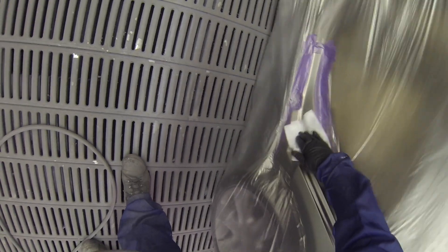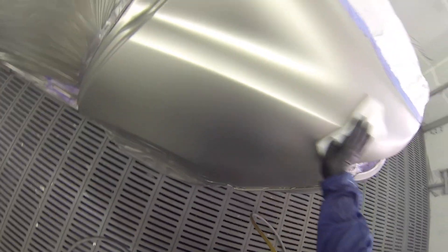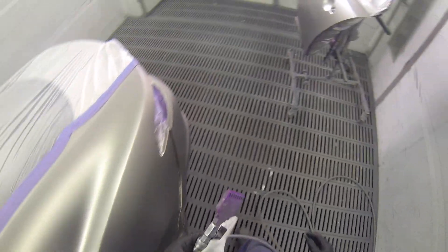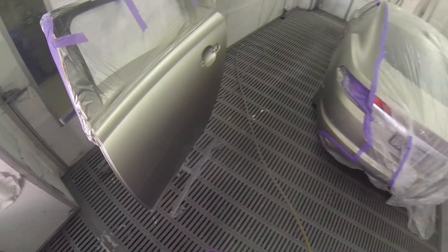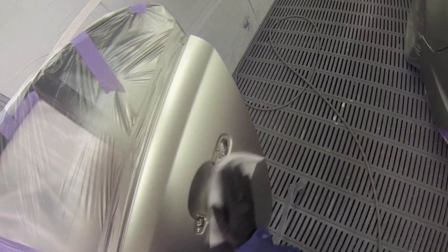Seeing as I've put so many coats on and it is a bit of a sparkly color, I'm just going through and tack ragging everything down — making sure I've got no dry spray, no dust and dirt sitting on my panels. I do do it; you won't see me doing this every single video as it gets a bit boring to watch, but this is just to show you guys that I actually do it.